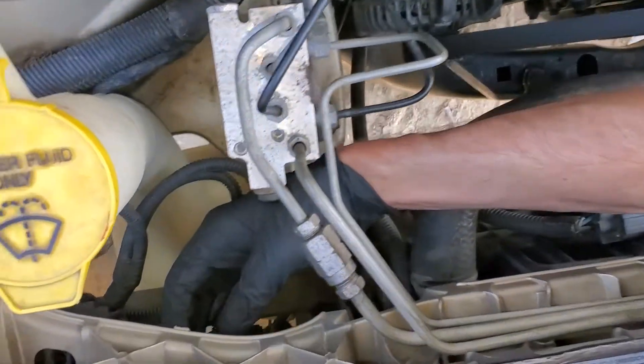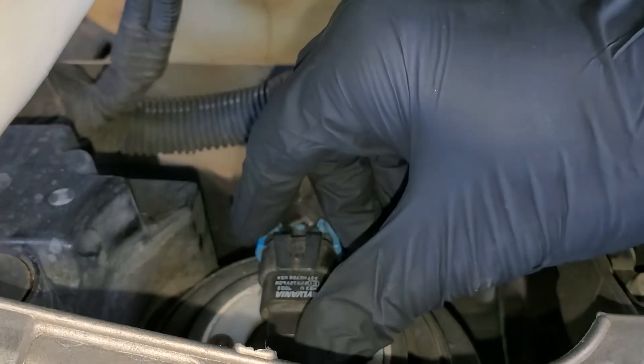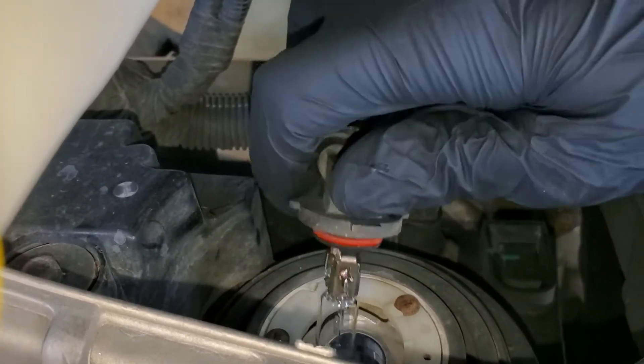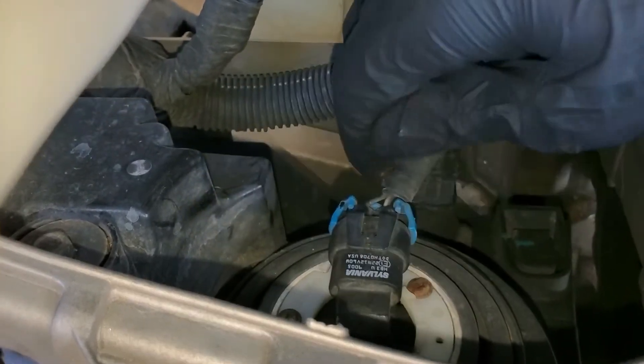You can see here, I've got my arm kind of looped in through the side, getting at the high beam. You can just grab the entire assembly and rotate it counter-clockwise and it will come right out. When you install your new bulb, please take care not to touch the glass. You just pop it in there and rotate it back to where it was.